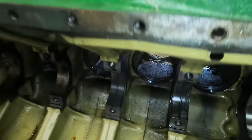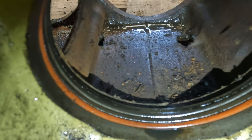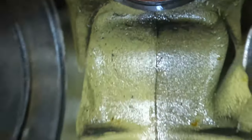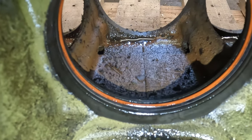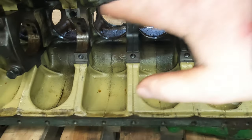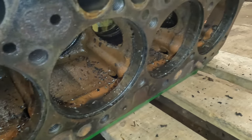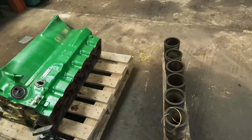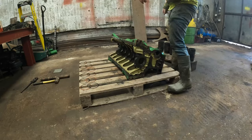Back to these liners - they're all out as you can see. In the bottom there's three O-rings. The top one is a square one and that's come out on the liner. What I found quite interesting was that the red one's on the bottom, but in every other one it's in the middle. So there's either a reason for that or somebody made a boo-boo when they rebuilt this engine last. There's two O-rings in there - I'll take those out and blow all the rust out of the block because that's where all the coolant goes. I'll just get that nice and clean and then have a test fit of the new liners. Turns out all of them had shims on, which I was a bit surprised at, but it doesn't necessarily mean the new ones will need shims - we'll measure it and find out. All the O-rings are out now.